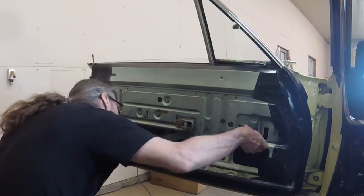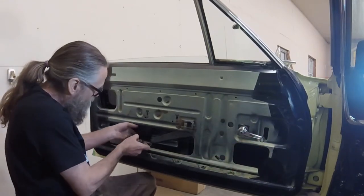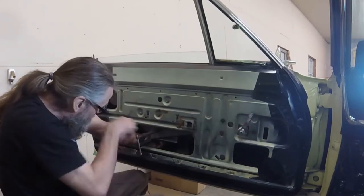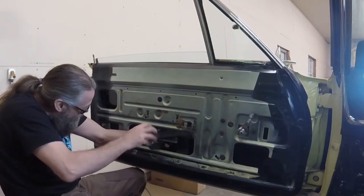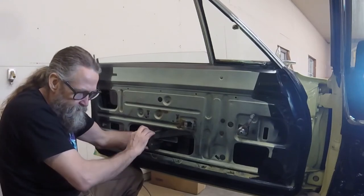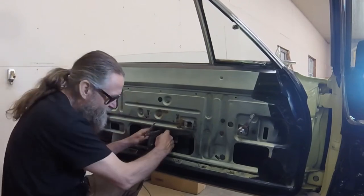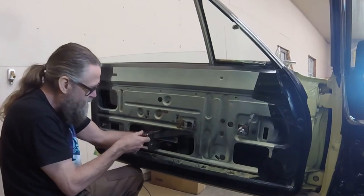The nylon rivet is actually made up of two tight-fitting parts, the outer portion with the prongs and a cylindrical center shaft that can be slid flush with the four prongs, thereby locking them in place. I slid the center shaft into its locked position by using a C-clamp. There's not much room to work, and I didn't want the C-clamp making contact with the glass, so I took my time.